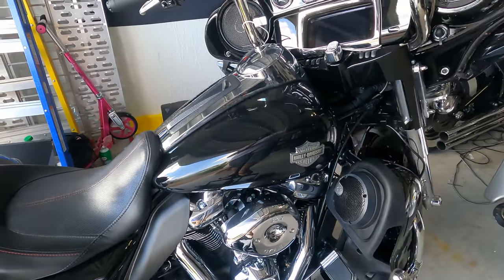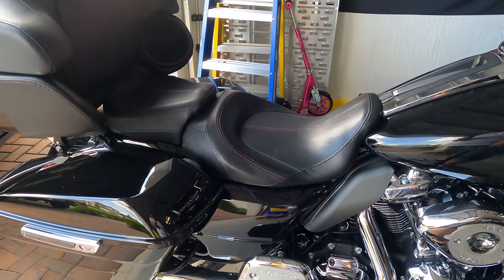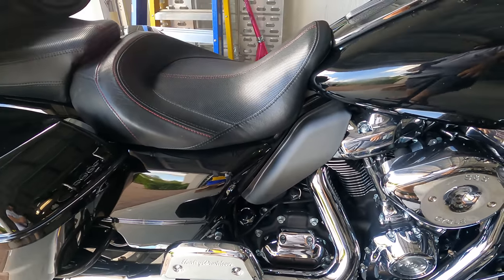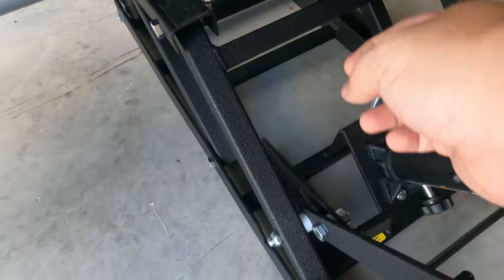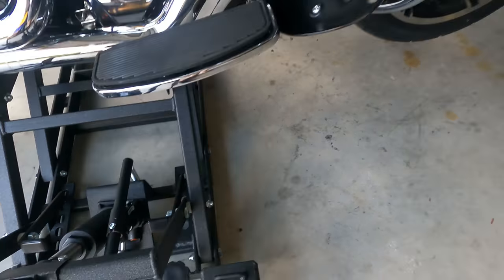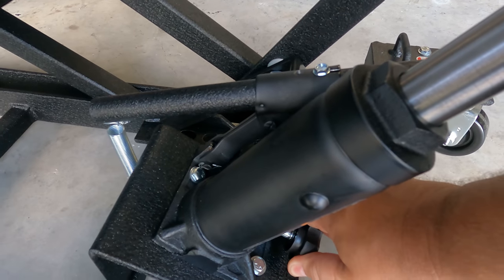I grabbed the handle out of paranoia and bring her up. My ski is a little to the right of the oil cap — so even I didn't do it perfectly. You pump her up as far as you want, then flip these catches over like that — those stop it from coming back down. This is the release valve here, and you just turn it real slow.